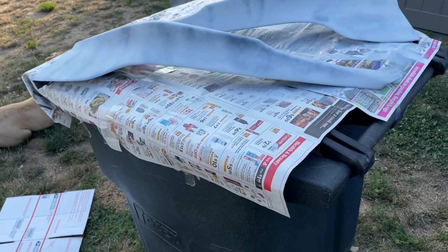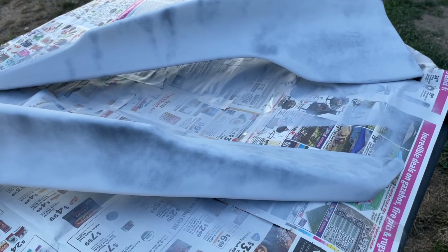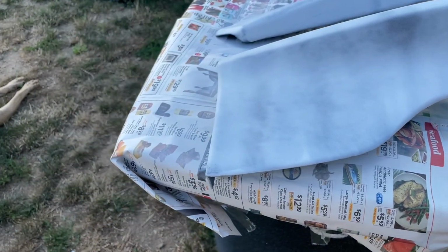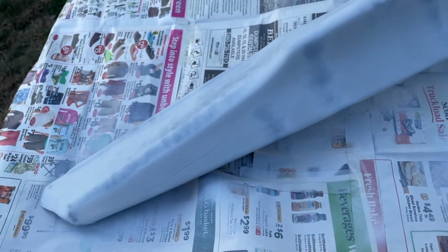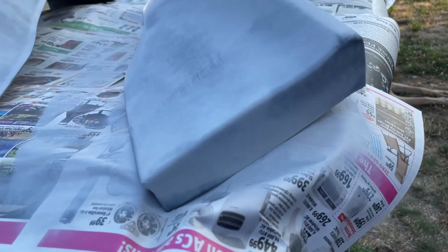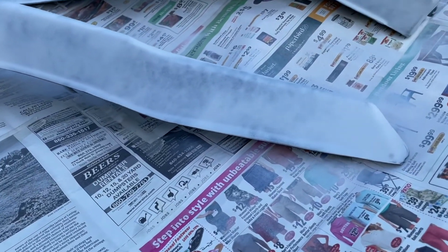So the way I'm painting this is probably like a horrible idea, but anyways, this is after one iffy coat of primer. I might do just one more and sand it down really quick with 600 grit just to make it smooth and stuff. Because like here, look how close I got. You can see it's running, so get rid of some of that run. Might do one more coat and then, yeah, I definitely got a little too close right here as well. So yeah, probably gonna sand it with some 600 grit and then do it all over again.